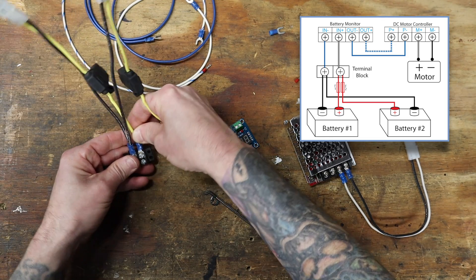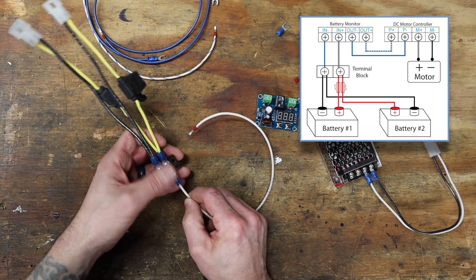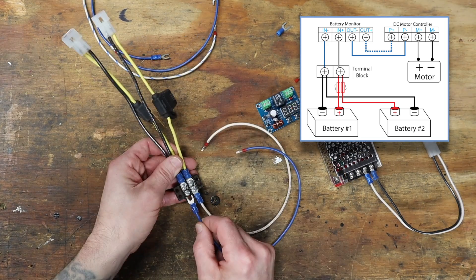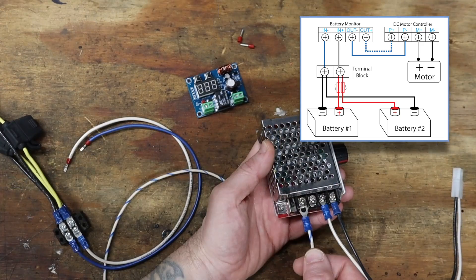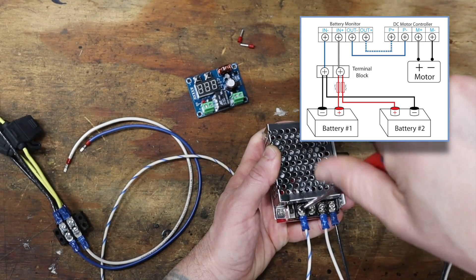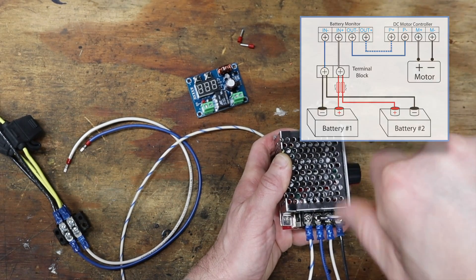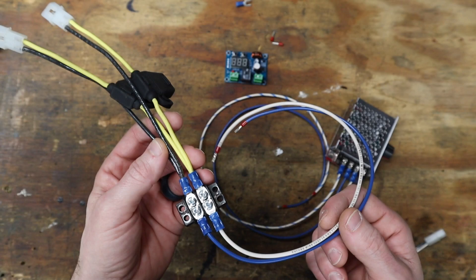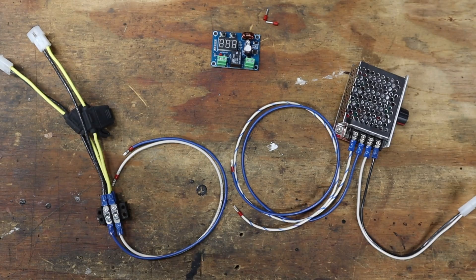You'll notice that after the battery terminal I use a white wire for my positive lead, which is an unconventional color for a hot lead. This is because the vehicle itself uses white as a positive lead, and I wanted to keep some consistency in the diagram. I also use blue and a blue-white stripe to clearly identify the output leads of the cutoff module when it's mounted in the vehicle. I'll put a link in the description to the wiring diagram, as well as the terminal block and the low voltage cutoff module I used.